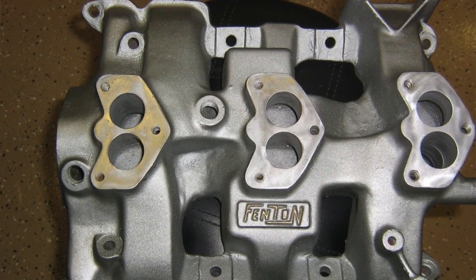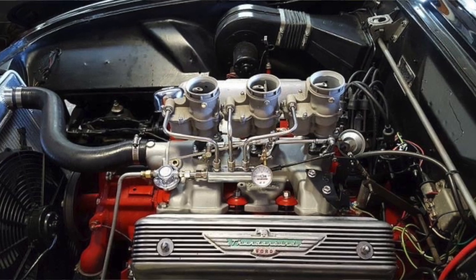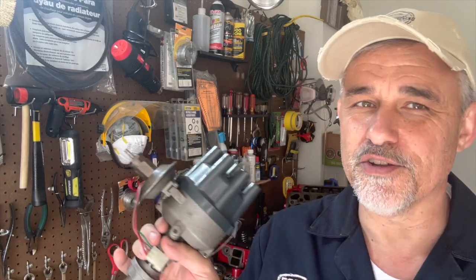That's why this upgrade is very important if you're going to run your Holley 94 — or maybe you're going to run three deuces with three Holley 94s. On that three-deuce setup, get yourself a 57 to 64 distributor. This is a better distributor than the Load-O-Matic, hands down. It really wakes up a Y block and does well with the advance. Understand, this carburetor came with a spark control valve and a port that feeds a lot of vacuum even as you're accelerating and decelerating, which made the original Load-O-Matic very responsive.